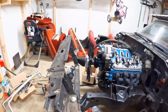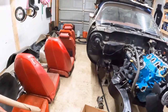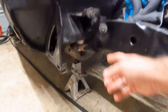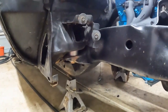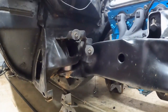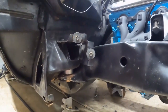Anyway, I wanted to go over this because I think a lot of people at this point in time — if you haven't done it, it's time to do it. When you've got this body mount — this little puck made out of rubber — and it's 40 to 50 years old, these things just deteriorate. The bolts rust from all the flex, and it's just not good.